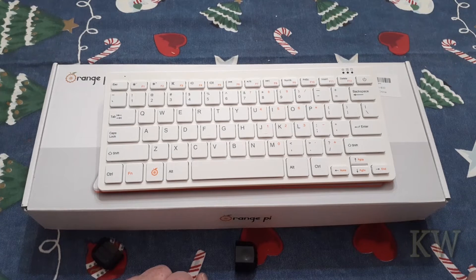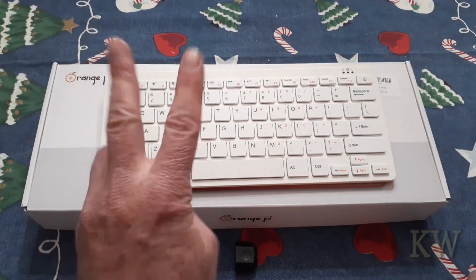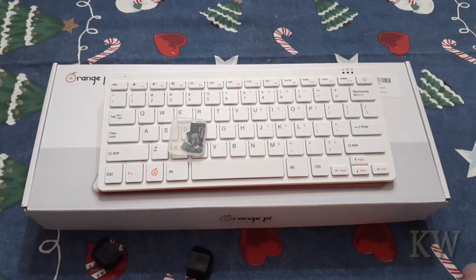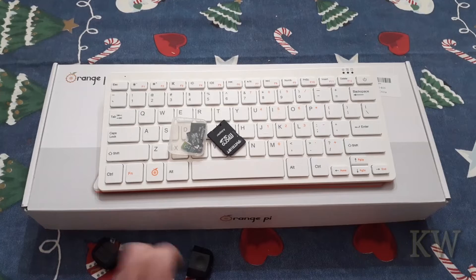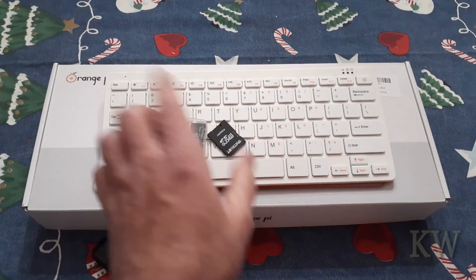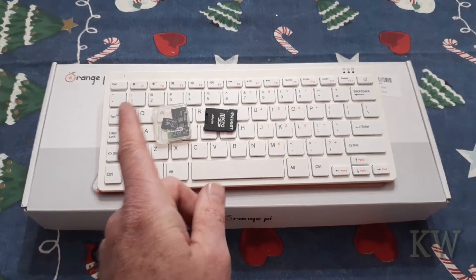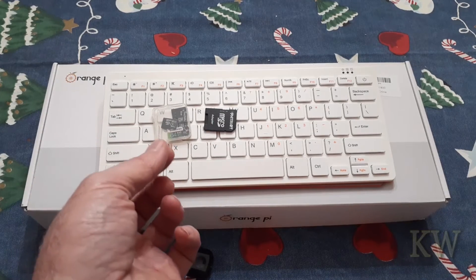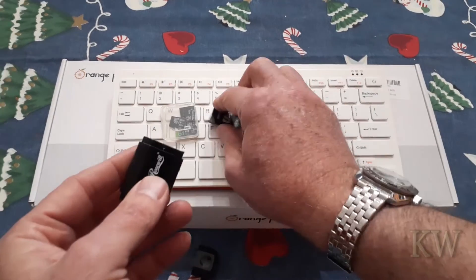Finally I found the official instructions, which are not very clear, but there are two key tricks. First, your SD card needs to be about 8GB or more and fast. The problem is the flashing software won't detect an SD card plugged directly into your computer — I tried different cards and it would never detect them. It would detect a USB drive though. So I got a USB-to-SD-card reader, plugged it in, and instantly — problem solved.